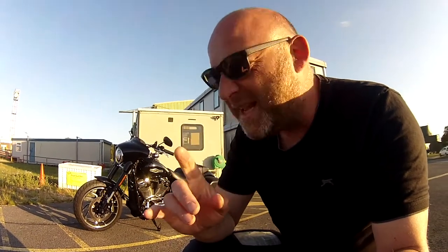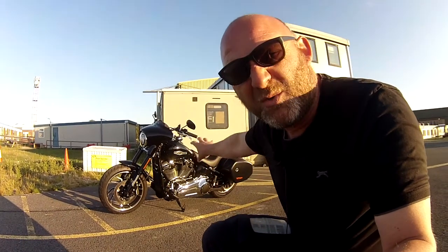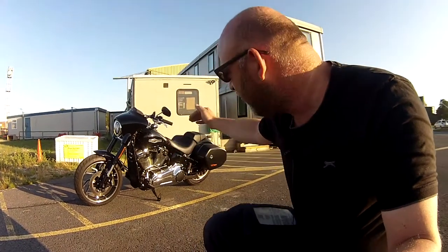You kinda have to wait a few seconds for it to readjust itself. The way it does this is through what's known as an accelerometer, or a kind of a bank angle sensor. That's stored within the BCM — the body control module — on the electrical side of the bike on the right-hand side. Basically, that senses if the bike is leant over too far; it also senses if the bike is moved when the alarm is on, and that's what sets off your alarm. So it's this accelerometer which actually controls what the bike is allowed to do. If it senses the bike has been leant over, it won't allow the bike to start.